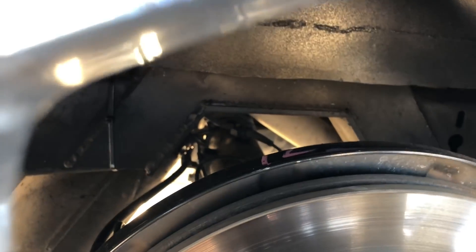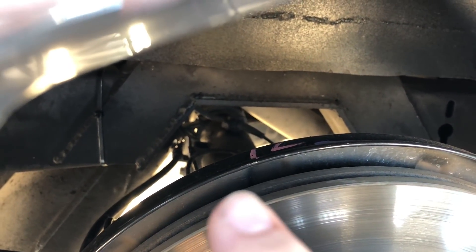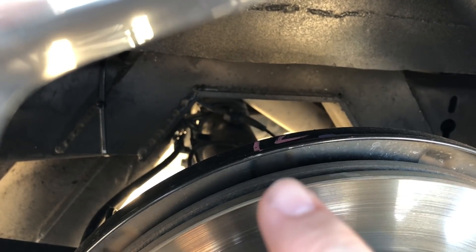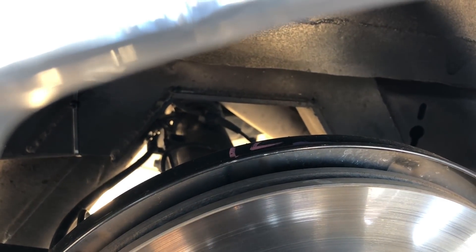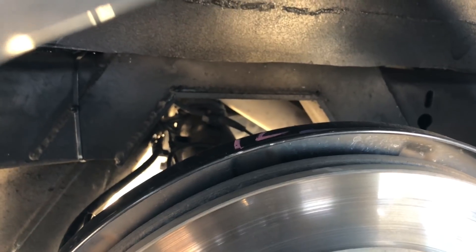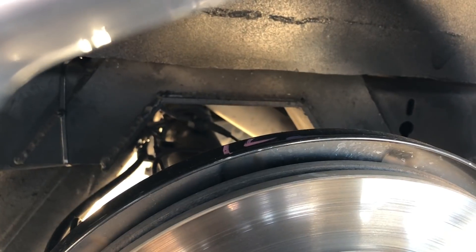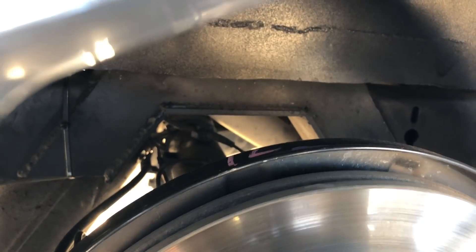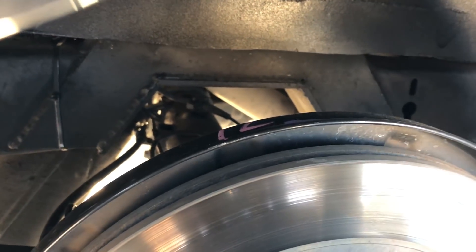Basically, whenever my frame was stock, it was going all the way across, right? So my axle had what were called bump stops — my frame had bump stops under it. A bump stop is like a little rubber piece that goes there so that way when the axle hits it, it's not hitting the frame. When you go low enough you're gonna hit those bump stops pretty often. So what I did was I had them do a c-notch — they cut the frame there to allow my axle more travel to go upwards. I personally took off the bump stops to give it more space. With this c-notch, if I had my bump stops up there I'd probably hit them every now and then, so personally I take them off.